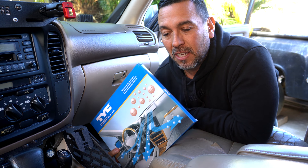Let's go ahead and start and see what it looks like — it's going to look bad. One way I noticed my cabin filter is bad, especially because I do a lot of off-roading, is I see more condensation dripping out of the drain in the engine bay. Not only that, but the smell that comes out of the vents too. So let's go ahead and start.